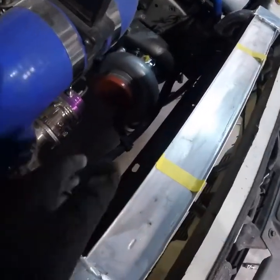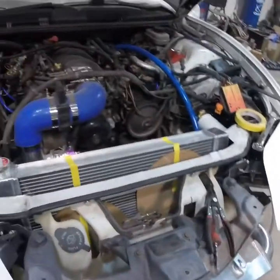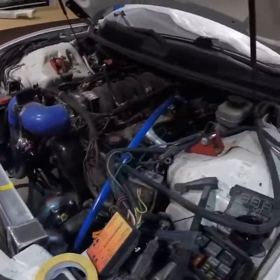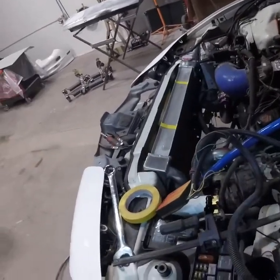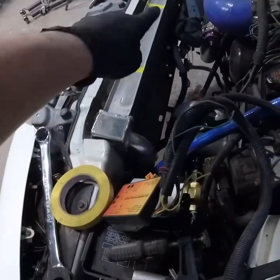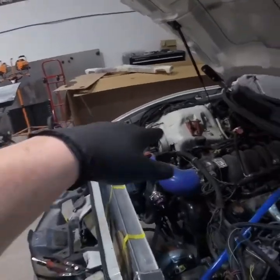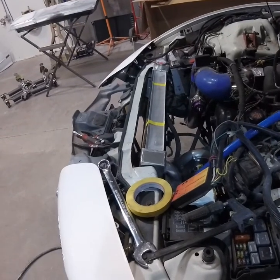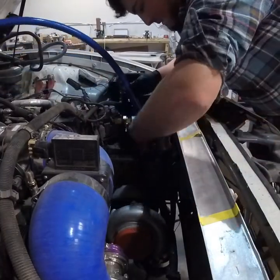There is room in here but I'm wanting to put my transmission cooler - I've got a transmission cooler fan I'm going to put right here. I eventually want to get a condenser back in here for AC. I'll need a smaller condenser because the current one is too wide and hits the water inlet and outlet. I can make some fittings and hoses to make that work.